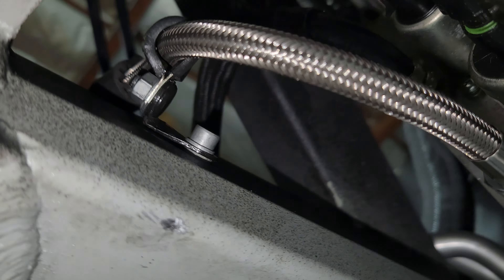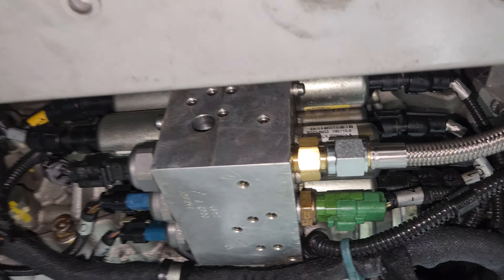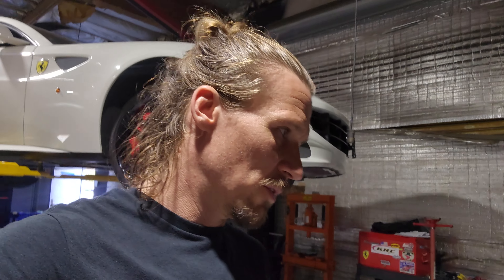And then on the backside, we use another clamp right here — this is the factory clamp, but we just move it from down here to here. There's already a rivnut there, so you don't have to put any new rivnuts, and we just feed it right in here and boom, problem solved. We have it on our website, hollywoodmechanic.com — you can buy it. It comes with the fittings. If it ever were to fail again due to just age, it is a Teflon-coated stainless steel braided high pressure line. I think it's rated to 2000 PSI, which the PTU only operates at about 850 PSI. But overkill is always better. And if in the future it fails, you can just have anyone make it because it's a dash six fitting now — you can go to your hydraulic line makers and they can crimp you a new line.